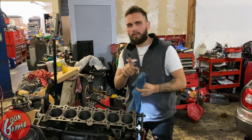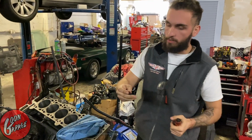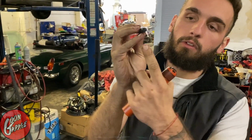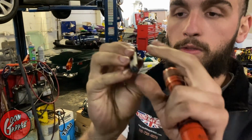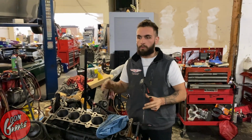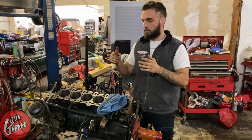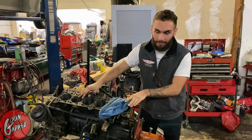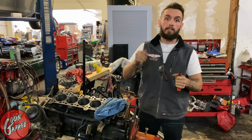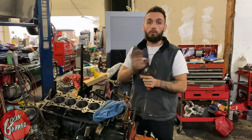Hey, also I forgot one last thing, a little tech tip for you guys if you're doing it at home as well. Highly recommend you get yourself a set of punches that look like this, right? There's a little embossed letter or number on the end of it, and use a hammer to smack it into whatever object you plan on labeling. The reason I bring this up is when we tore this thing apart, we saw that the bearings were in good condition, and since we're doing a relatively low dollar build and trying not to put too much into a motor, given we weren't expecting to do this anyways, we decided we were going to mark each piston and connecting rod as a set, including the rod cap and in what direction they were facing.